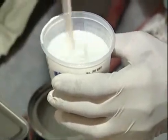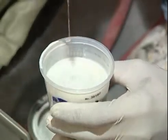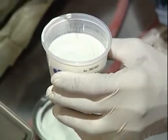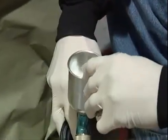The larger the nozzle, the more even the spray pattern on the vehicle surface. But for what we're doing, the evenness doesn't play a part right now. And the viscosity should, for me, be about a half a second in between each drop. I think we're ready to go now. I'm going to load it into the gun right now.